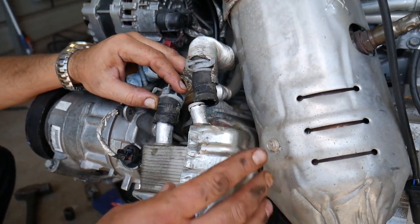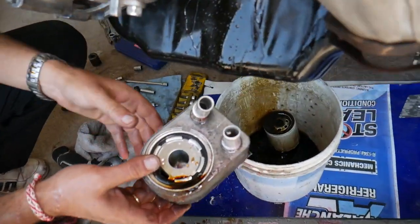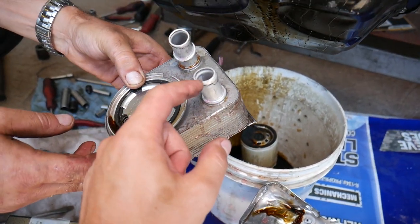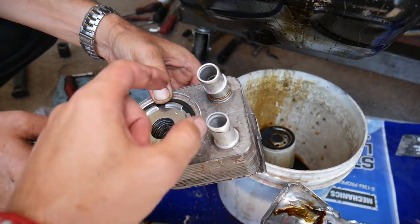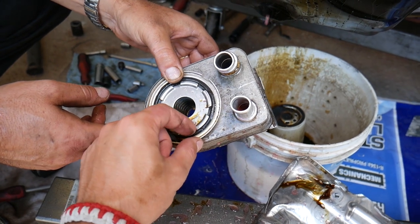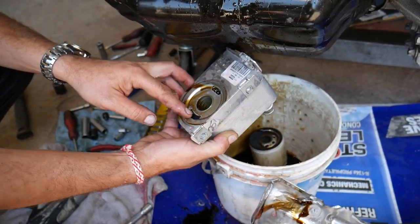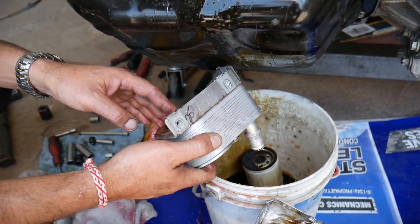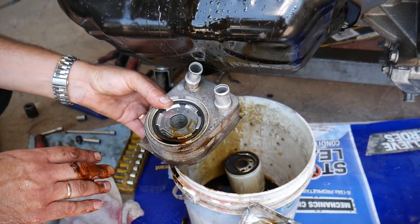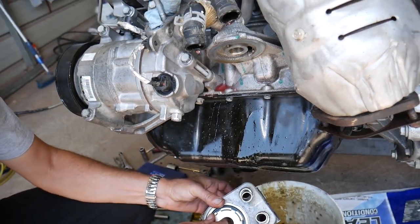Gently collect it - we got it out. Be very careful how you move the hoses with the pliers because we made ours look a bit oval - we flattened them slightly, so squeeze them back. This right here is your gasket - it's practically integrated into the oil cover. You may be able to replace it separately - we'll have links in the description below. If you develop a leak, it's from that gasket. Hopefully the video is helpful. Putting it back together is in reverse order with 2kg of torque. Don't forget to bleed your cooling system - we have a video on the channel for that. See you guys next time.